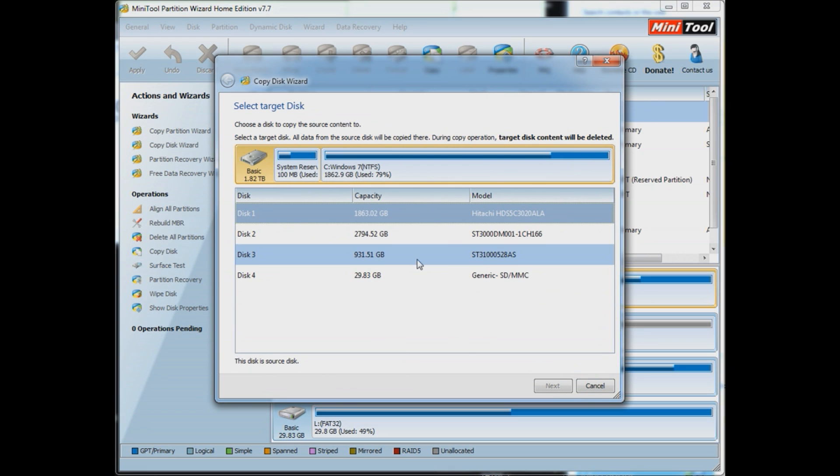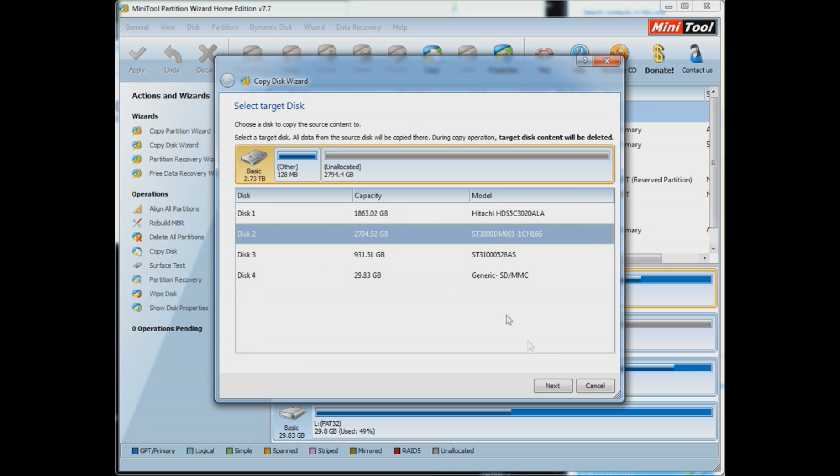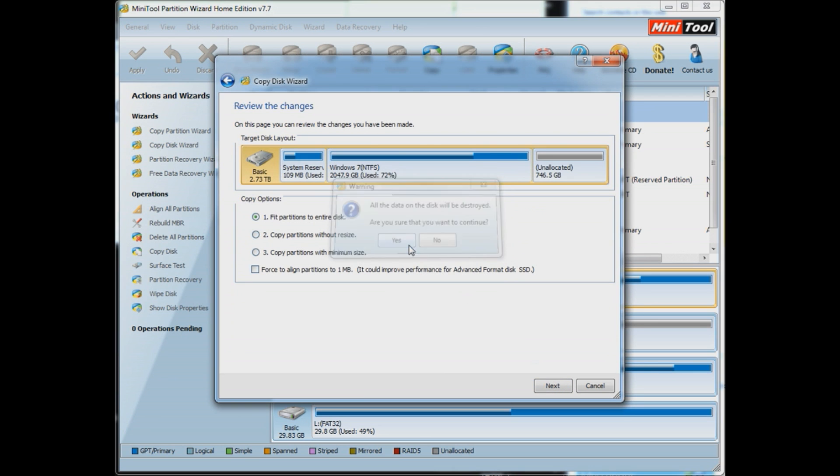You can't clone any disks or partitions over to a GPT format disk — that won't work because it'll have to be reformatted as MBR. So what you need to do is delete all the partitions on it and then reinitialise it. If you've got Windows installed on it and you want it as the primary, you've got to reinstall Windows.